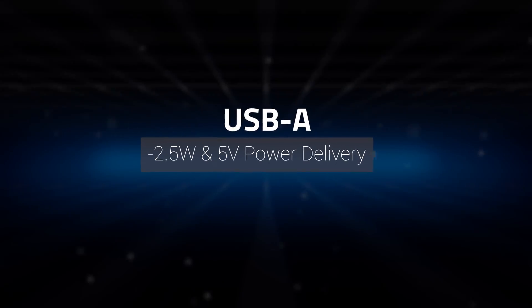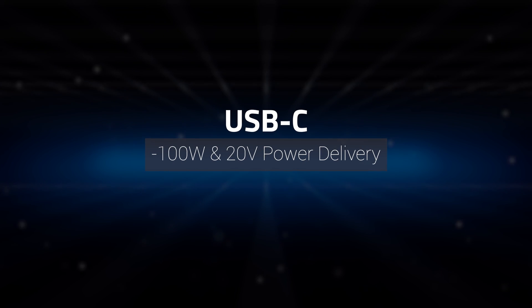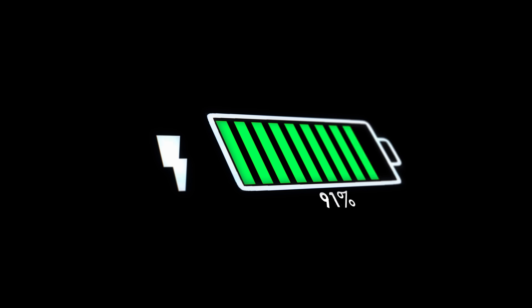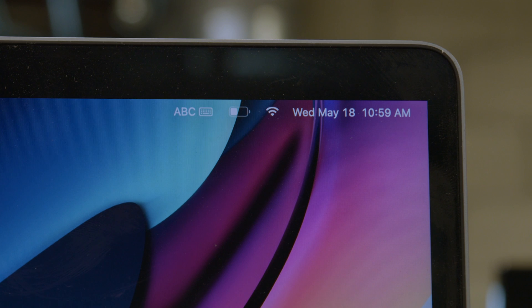While USB-A could only support up to 2.5 watts and 5 volts, which was fine when that technology was first introduced, nowadays devices require so much more power. So USB-C now supports 100 watts and 20 volts of power delivered. The practical benefits of this include pass-through charging, enabling a USB dock that powers laptops and also charges other devices simultaneously.